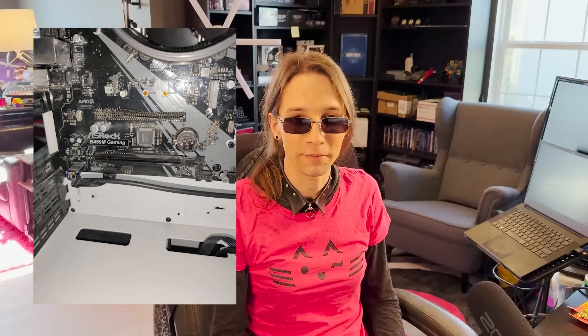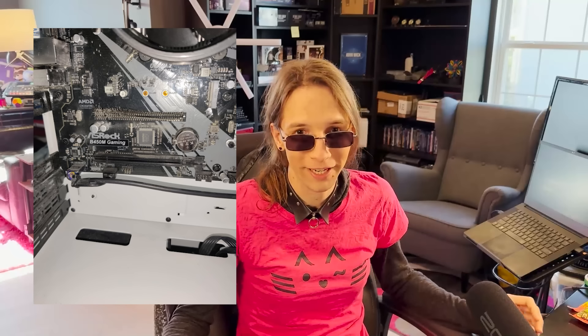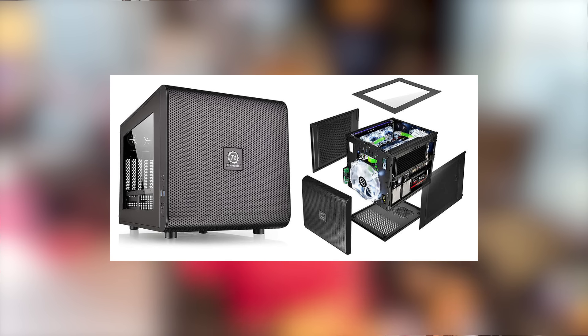When sockets like these were beginning to be designed, GPUs were tiny and they've gotten bigger and more powerful. They are not structurally engineered for this. I've seen a few tiny cases where the motherboard actually sits on the bottom and then the GPU slots into it from the top, which I actually think is a better way to do it overall, especially if you're going to ship the case. If you're going to move it yourself and you know it's going to stay in that orientation, as you jostle you're bracing against the case instead of having the entire weight of the GPU on that socket.